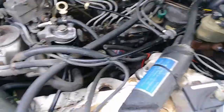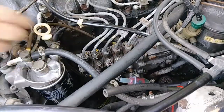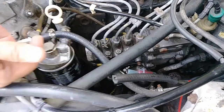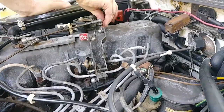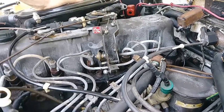They just snapped off. You did the fuel pre-filter — nice! That old filter was full of black sediment. I was hoping it wasn't algae. I did the main too. It looks nice. I also took these connectors off and lubricated them to clean them inside, and greased them. That makes a difference.